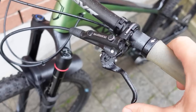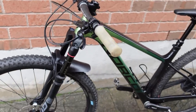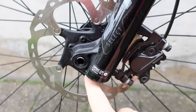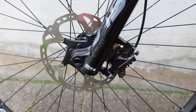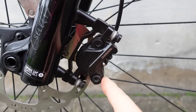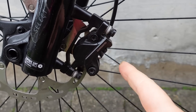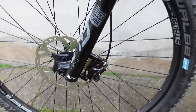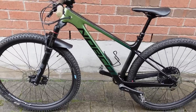So what should you do if you get a new bike with the MT500 brakes installed? At the minimum I would say replace the disc with something better — this is an XT RT86 but even the SLX would do. If you want the bite and longevity of metallic pads or the ability to run finned pads, just get the Deore M6000 or even the new M6100 that I reviewed not too long ago.